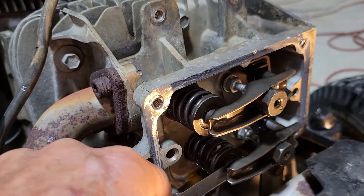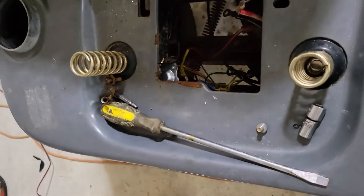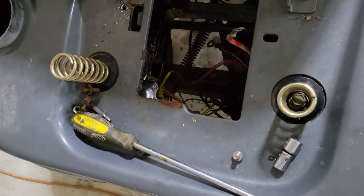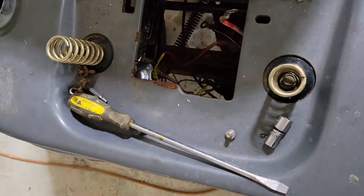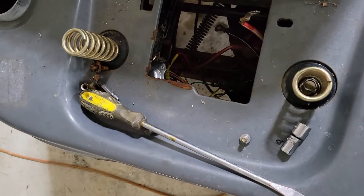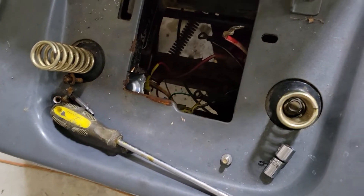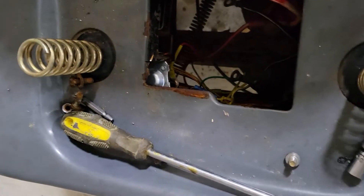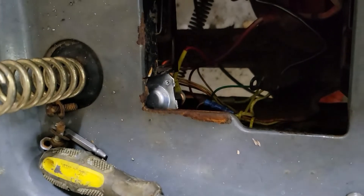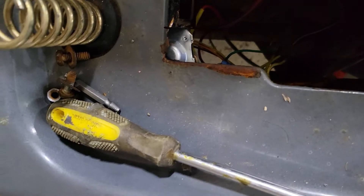The new solenoid is a piece of crap. I got it off Amazon — the $9.97 special — super cheap. I used it twice and now the contacts are welded, so it runs all the time. The starter can't disengage because the solenoid won't let go. I'm going to change it, and I'm of the strong opinion that Craftsman put this in a very bad place. Once I get it out of here, I'm going to run new cables and move that solenoid.